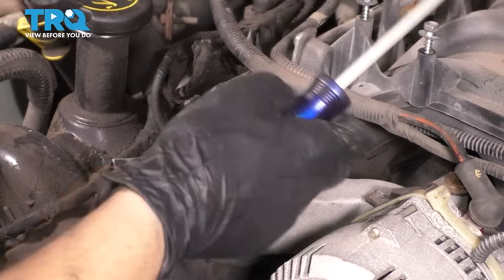All right, let's put the lower oil pan bolts in. There are four of them, 13 millimeter headed bolts. Slide them in, thread them on by hand. You don't want these cross-threading, of course. And the torque for these is in a specific sequence also. 1, 2, so the furthest ones first, and then 3 and 4, which are the middle ones. And those you torque to 15 foot-pounds at first, and then an additional 60 degrees. And now 60 degrees.